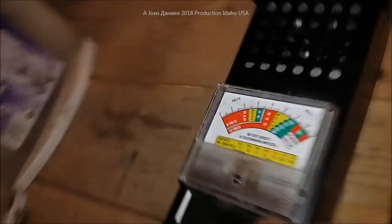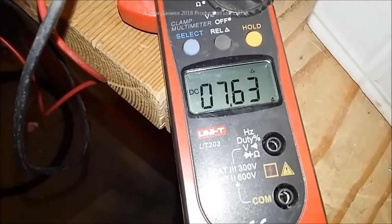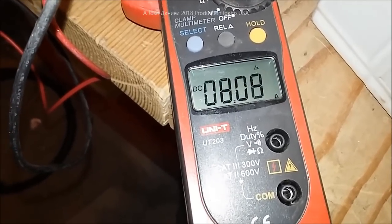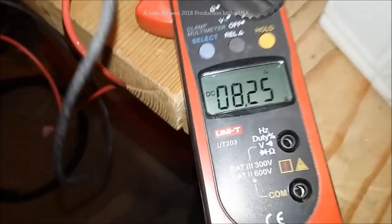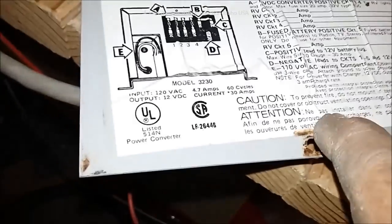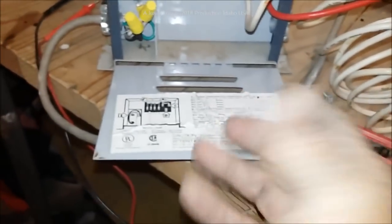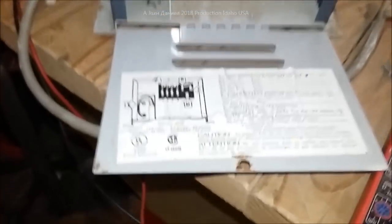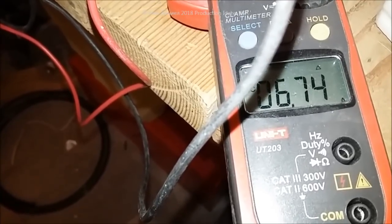I'm going to show you the load. You can see the needle at about 13.8 volts — we're going to put a big load on it and I'll show you how the amps go up. There's the load — watch these amps. Up they go. Hold this and see when it starts to slow down — that's about your peak. My peak was 8.3 charging amps; this unit is rated at 8.8 charging amps, so that's exactly what it's supposed to do. If your rectifier is bad it could literally spike to 40 amps. In this case it worked perfectly.